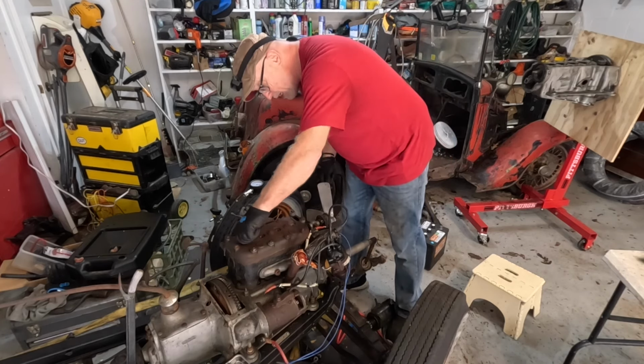Let's spray it down a little bit with our good stuff. Let's see if any of these fit. Loosely, what is that? That is a quarter Whitworth. 5/16 Whitworth's going to be bigger. Quarter, 4/16. This one's too small. Too small. That is 3/16. I mean, we could try it with this. Seems too loose. It's not going to be metric again, all this crap. BS is the most likely, right? So that's a Whitworth set. And our wrenches are not Whitworth, are they? Our wrenches are way too big.